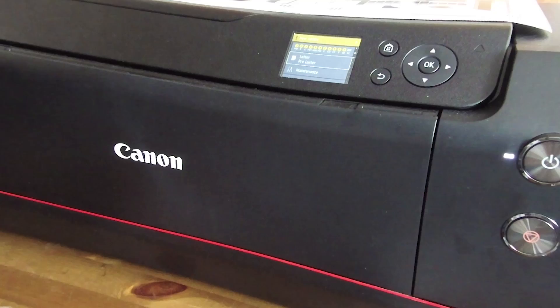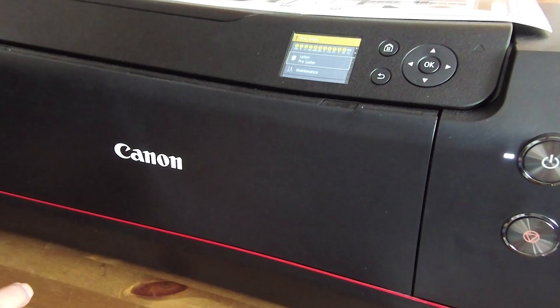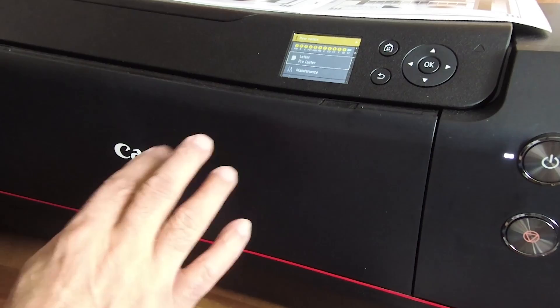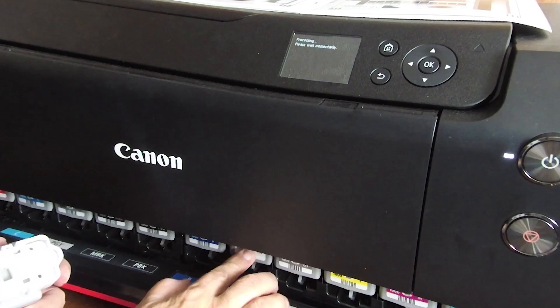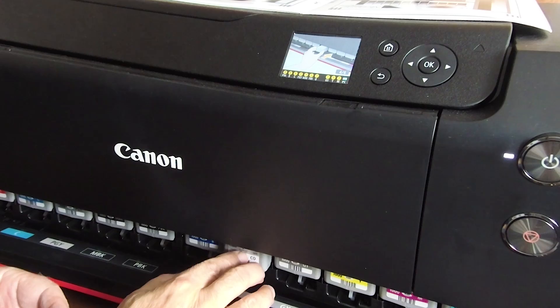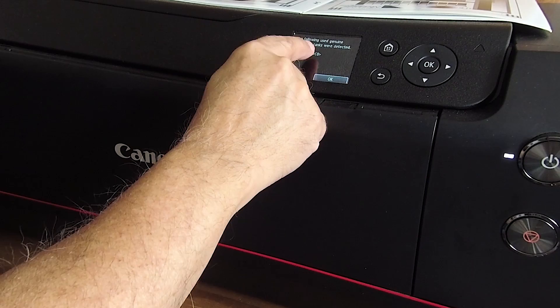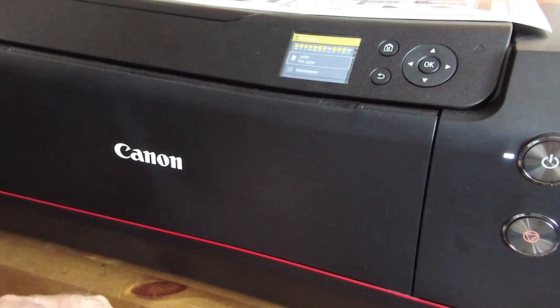Wait — I forgot to show you one thing. You must be asking: do these cartridges actually work? Are they recognized by the Pro 1000? As you can see, everything but photo cyan is marked as low — I measured and weighed them, they have about 10 ml left. Let's go ahead and test the one we just filled with chroma optimizer. We'll remove the existing one, reinsert the one we just loaded with ink and the new chip, close the door, and wait for it to recognize. It says: 'Used genuine Canon ink tanks were detected — PFI-1000 chroma optimizer.' And as you can see, chroma optimizer now shows as full. I consider this a total success. Thank you again for watching — don't forget to subscribe, share, and like. Happy printing everybody!